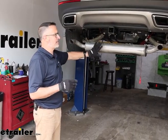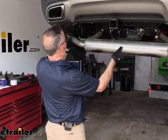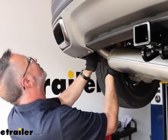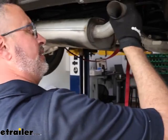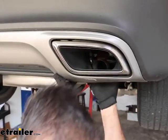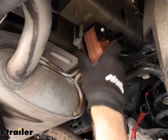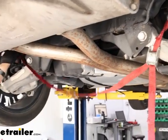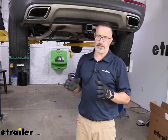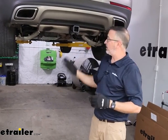With your hitch torqued up to factory specs, it's time to replace the exhaust — just like when we took it off. Leave yourself enough slack down here and slide it up into place. Push it over toward the driver's side as much as you can, then come underneath to the rubber isolators. With the exhaust mounted, remove your cam buckle tie-down strap. With your exhaust mounted, the only other thing you'll need to do is replace the two plastic boxes on either side of the car by the wheel well. The center section we took out doesn't go back on — the hitch replaces that.